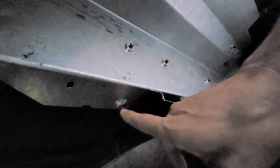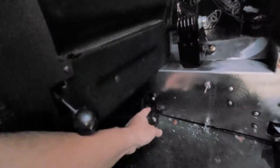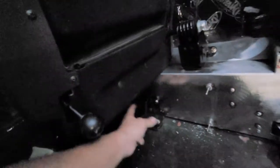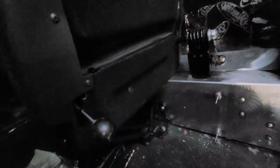Once I had that done, I went ahead and went from the bottom and drilled a hole straight through the center with a much smaller drill bit straight up, and did the same thing on the other side. Once I had a hole you can push this back — a hole straight through here — when I was inside I was able to put just the bottom base up against the inside of the tub. That allowed me to line up where the holes would be, and that small hole I then drilled with a much bigger drill bit — a half-inch drill bit — made the holes, and then I presented these brackets to it and marked where all the other holes were, drilling straight through. Now I was lined up.